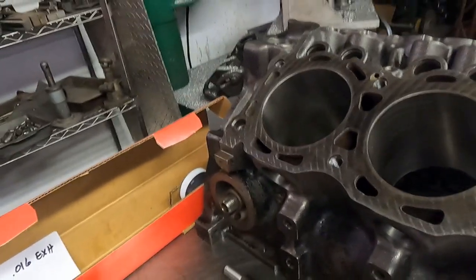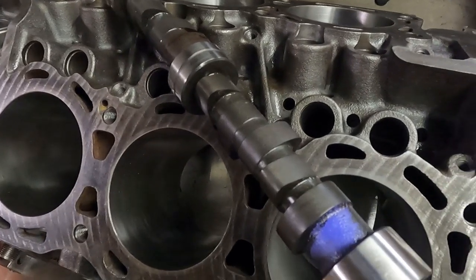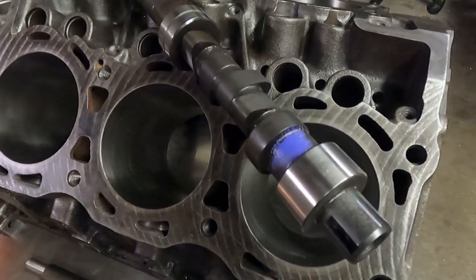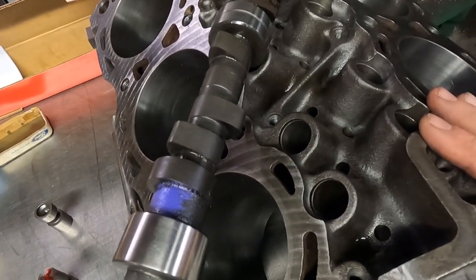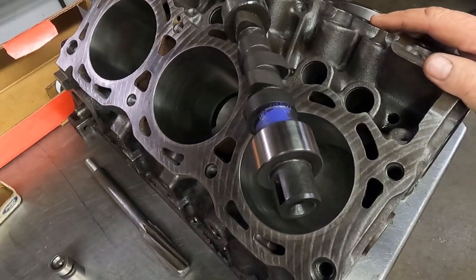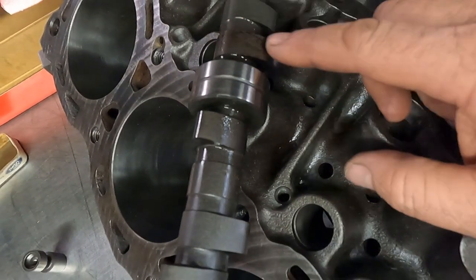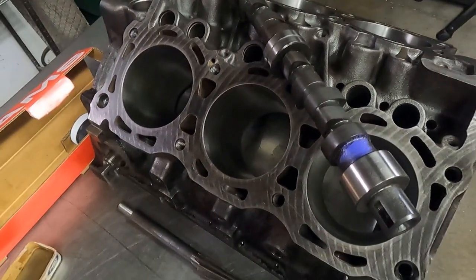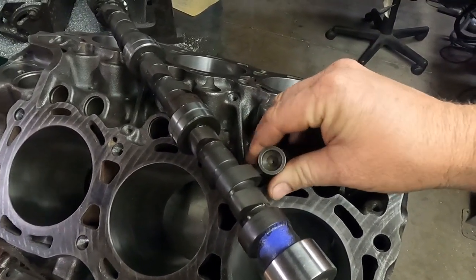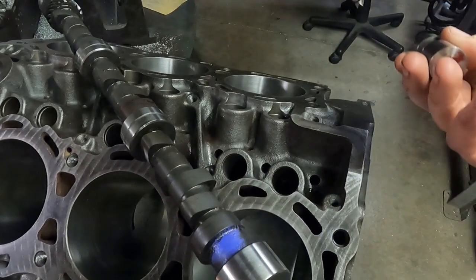That was just a little method I came up with to check the wear pattern on the camshaft. I obviously went ahead and checked these — the taper on the lobe and the crown on the lifter — because I have the tools. But I wanted to come up with a way for you guys, instead of purely installing this stuff and hoping it works out, to actually see the running pattern the lifter is going to take. It's sort of similar to the running cam we pulled out. Also, always make sure your lifters drop in your block and spin — that's a super important, really basic one to know.